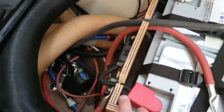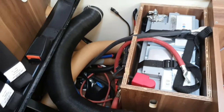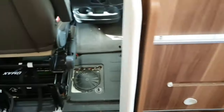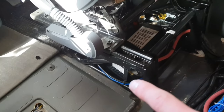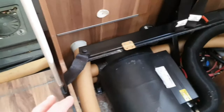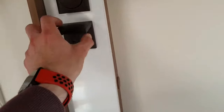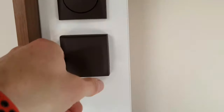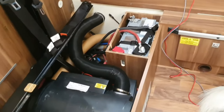I need to figure out what to do with the live — I'm going to run it over to the battery. I might use the original cabling since it's thinner and only going to draw maybe 20 amps at most. At the moment the van's in parts: you can see this is the inverter charger for 240V to 12V, and then there's my added inverter next to it. The inverter has a control panel and plugs, and I might run a cable to get power up into the main sockets when we're off grid. That socket currently only works on hookup.